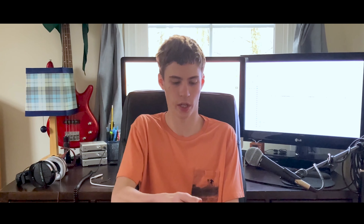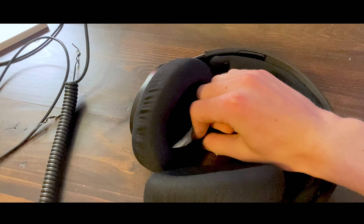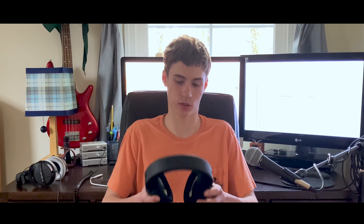To solve that issue, you'd probably think to just replace the pads, but you can't — they're glued to the headphone. So my solution is to make them thicker. What you can do is pry up the pad from the housing on the inside, and stuff paper towel near the back of the pad so it gets kind of an angle and keeps the pinna of your ear away from the foam. This is what makes these the most comfortable cans I own — my ears don't touch any part of the headphone.